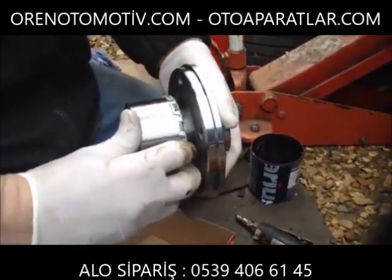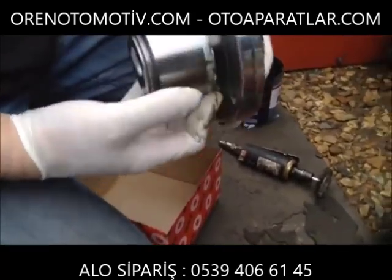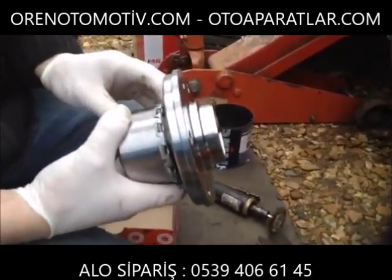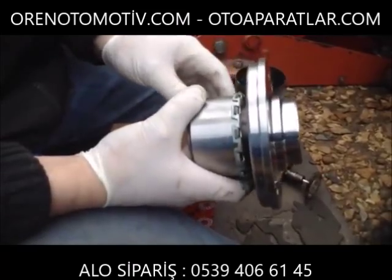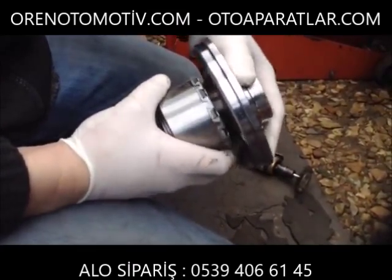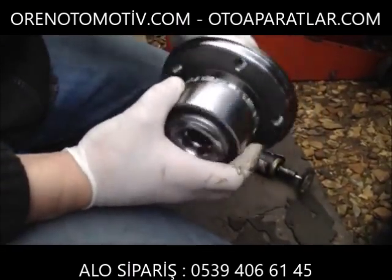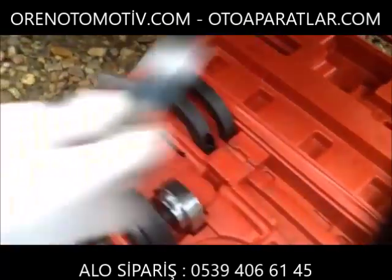Okay, this is the mounting clip. This is the most important thing that you need to inspect before you put it in. If these are bent in, buckled, or not far enough out, it won't seat home and could always drift afterwards. So you need to make certain that it's securely home, all the parts are in there and as they should be.